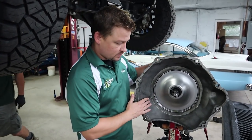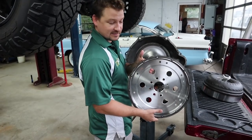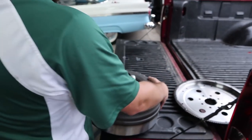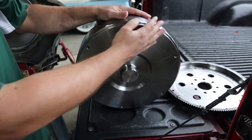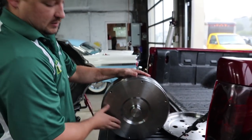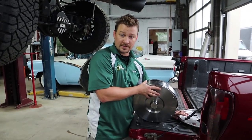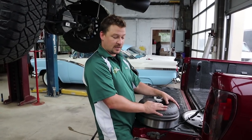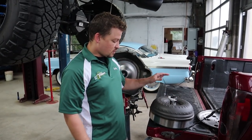You can see in the front here — this is the front cover, front pump seal, there's an O-ring and a snap ring. This came with our remanufactured pump. Even if we don't put another pump in, we always replace it. This is our non-flex plate — it's so thick and well-built it's not going to flex. And this is our Suncoast converter — all billet — and inside it has triple free-floating discs applied by a single billet piston, rather than a single clutch lining.